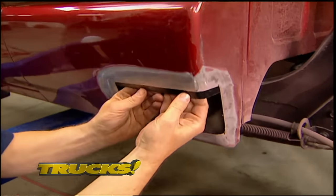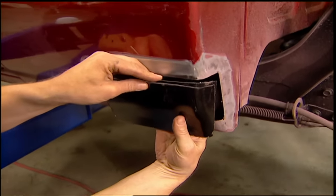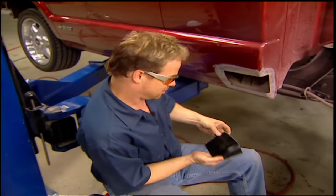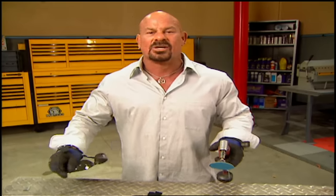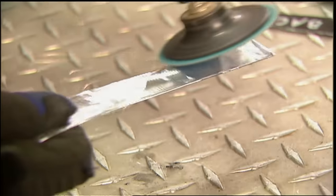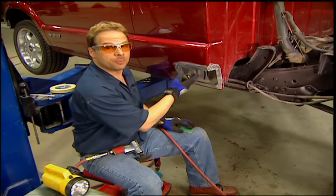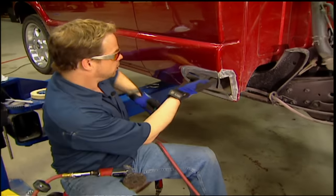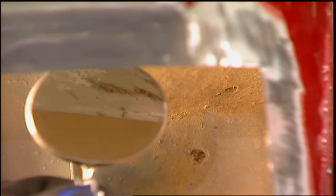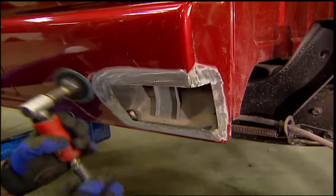Paul's just fabricated these backing plates that will give our patch something to sit on and the glue something to stick to. This allows us to create what's known in the welding world as a butt joint, which is usually tons harder to create than this. The adhesive really needs some tooth to bite into, so we're using 50-grit sandpaper to grind down the pieces and make sure we get a good strong bond. This part of the repair has to be prepped just like the backing panels — I took a fiber wheel on the inside, followed it with 40-grit by hand. Check it with a flashlight and an inspection mirror to make sure it's prepped right. One last bit of work: bevel this edge so the sharp metal edge doesn't show through your primer and filler.